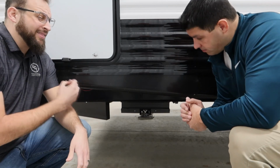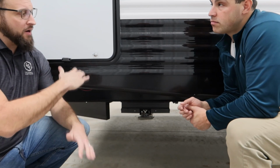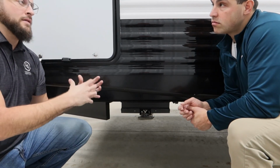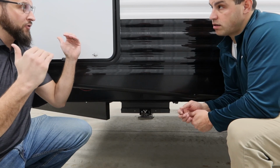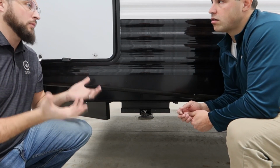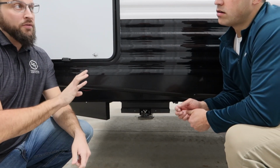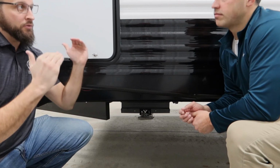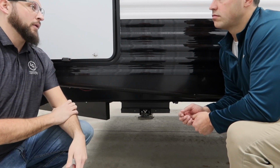Sounds good. Another thing that they'll want to note for operation is as they're running these down, the way the jack is designed, one foot may be in front of the other foot slightly. What'll happen is the one foot will hit and then the other one will catch up. And at that point, that's when we can put a little bit more weight on that system. So just a key is the jacks aren't broken. It's designed to actuate one to run a little faster than the other, and that's designed that way. Okay.